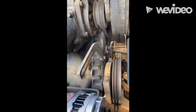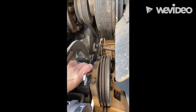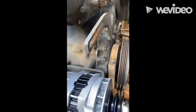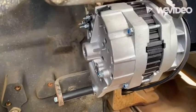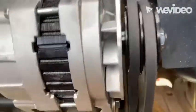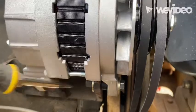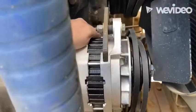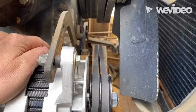On top of the alternator, we have the tensioner adjustment rod. You're going to have a 5/8 bolt here that you're going to loosen so we can move this, because we're going to have to adjust this slightly for the Delco-style alternator that we're now using. All the bolts and spacers that are provided — this is how everything should look. We have this spacer oriented this way, this other spacer underneath oriented this way, and then the top spacer. Once we put tension on this alternator, your belts should be perfectly aligned with the harmonic balancer.